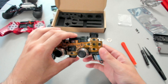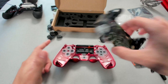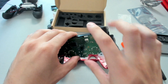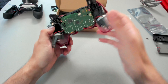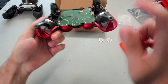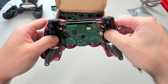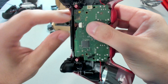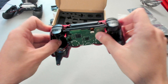Now it is time to reassemble everything. We'll take our front shell — the touchpad wire is going to have to go through that hole right there, so take your time. Slowly align everything up and slowly slide this in. Make sure that the wires for the thumbsticks do not get caught. Make sure that everything slowly slides into place. We're going to go ahead and reattach the cable for the touchpad — you'll see that white line butts up with the connector, and that's how you know you're fully in place.